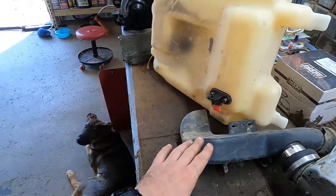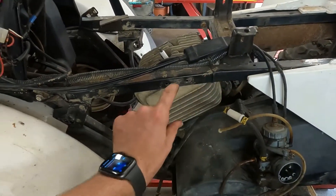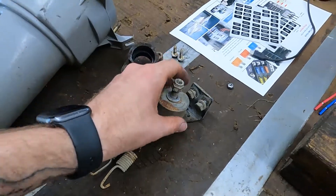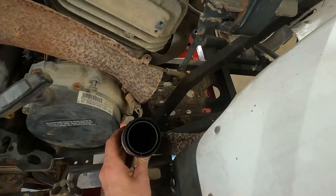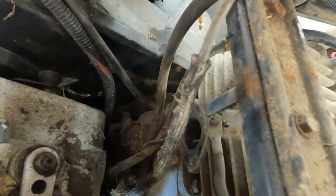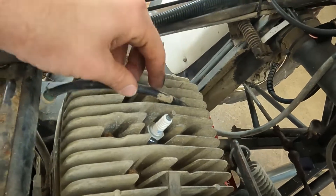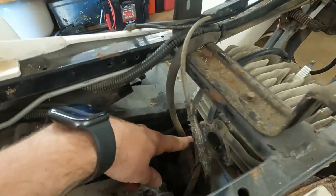This is the breather for the clutch which went on these two bolts right here, so I got that out of the way. The air box is out, I did take the intake boot off — this looks kind of rough. I took this motor mount off, which I will come back to. I took just this front piece of the pipe off because I think I can get to it without taking the rest off. I'm going to have to take this oil injection line off right here — this oil line goes down to the oil pump. I have that tucked up here right now until we get that nut down there broken loose.